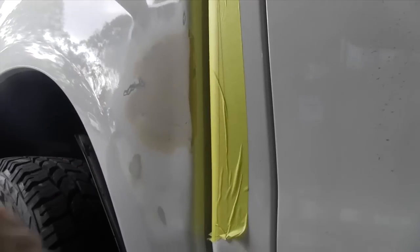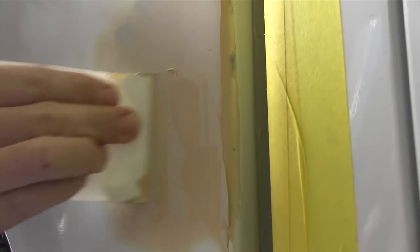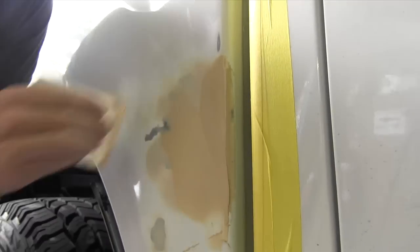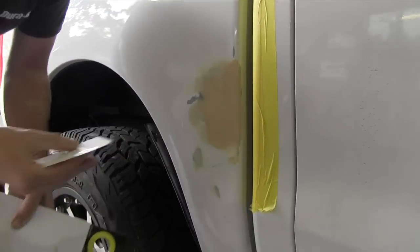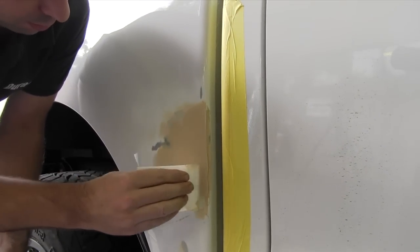We've cleaned out a couple of little pinholes. Now what we're going to do is just fill those holes — we're not trying to load up filler like we did previously. We're just going to wipe into those holes really nice and tight. So just a tiny little amount of filler on the corner of the applicator, concentrating on those holes — just go over the whole job wherever you see a hole, push it in and wipe it in nice and hard. Then clean the edge of the applicator, take a nice crisp edge, and just pull off all the extra.